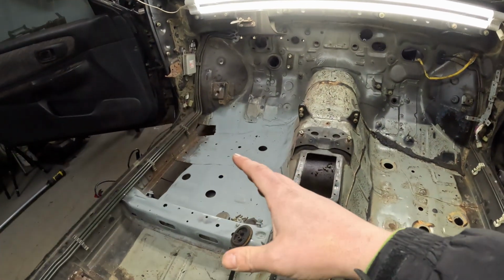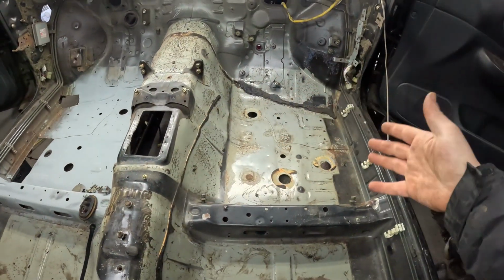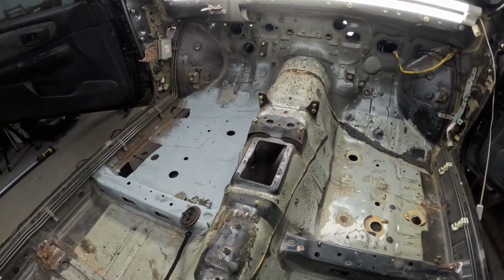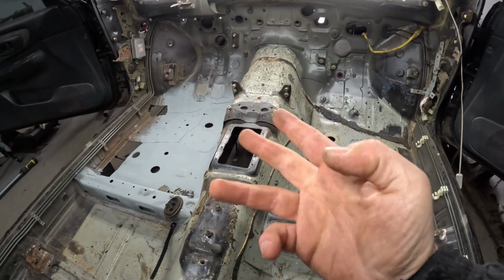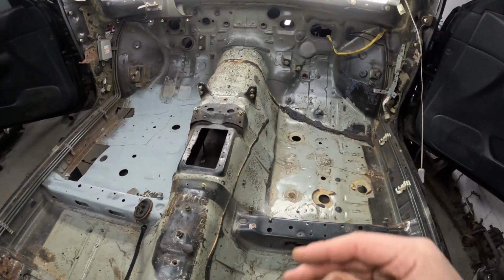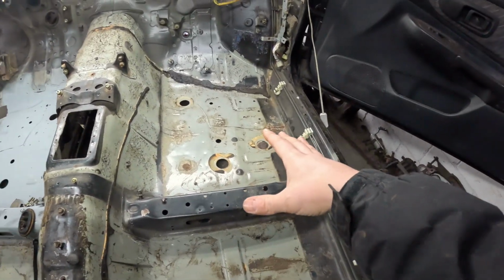If we can get everything like this across the entire interior, we coat it up with something that's going to stop it from rusting, whether it be the encapsulator, POR 15, or this zinc, just to cap off the rust after we knock it down where we need to. Obviously, we can just take the next steps, but I need clean metal to weld to, so in some places I'm not going to go too far, so when I'm ready to weld I can just knock down those areas and then weld in the pieces that we need.